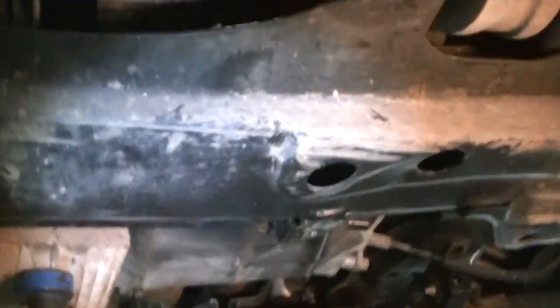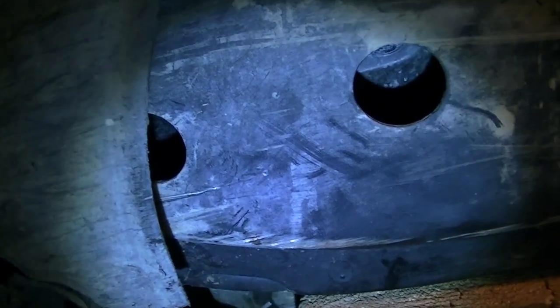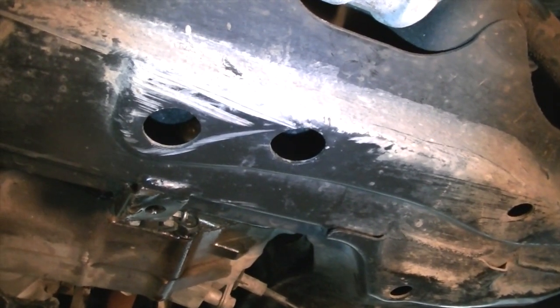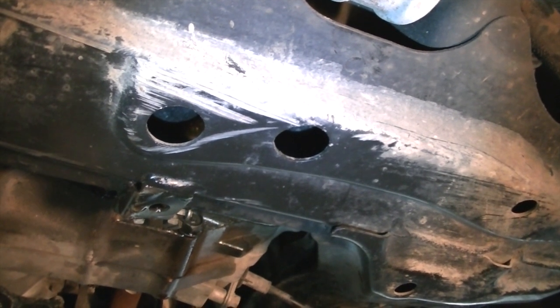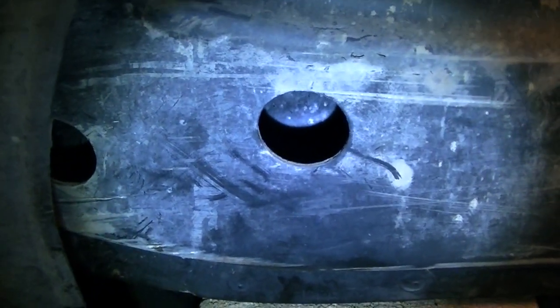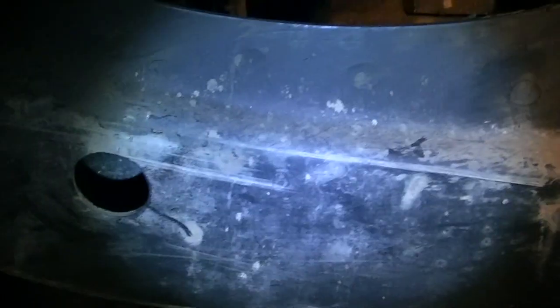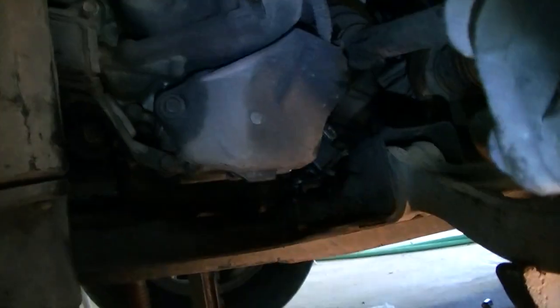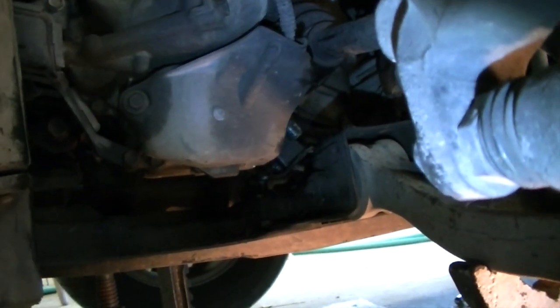You can see the four holes underneath — one and two, three and four — front and rear. When cranking with the socket, keep going until you feel them slipping off; if you pull off too early and the nut doesn't stay in the socket you'll lose it inside the frame, and while it's not impossible to recover, it's a hassle you don't want. I hope you got something out of this. I'm really glad to be working on a Honda — parts aren't a bajillion dollars each. Peace out, everybody, take care.